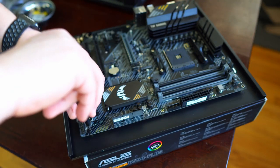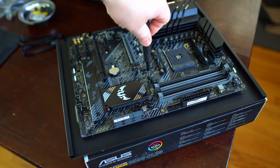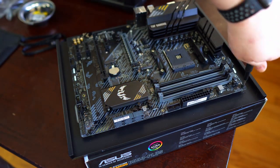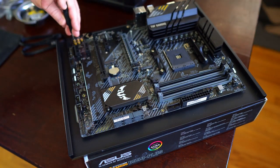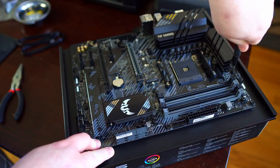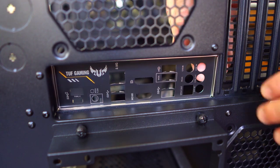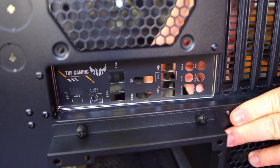After all the standoffs you need are in place, installing a motherboard with the tray out of the case ought to be pretty easy. Finally, I will say as one word of warning, pre-route your cables before you put the motherboard tray back into the case with the motherboard and presumably your CPU, RAM, and CPU cooler installed. In the long run, it will make for an easier overall building process of your PC.